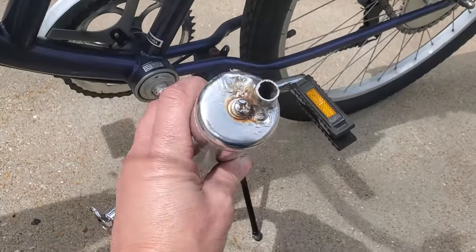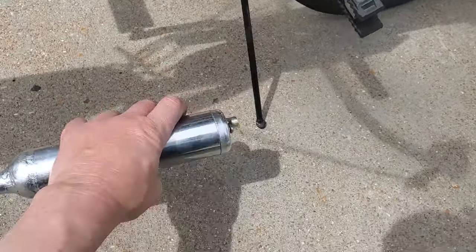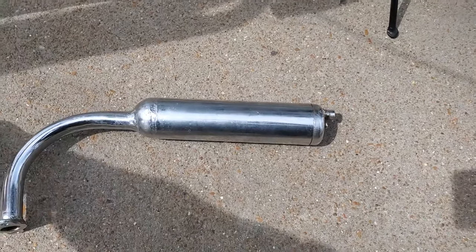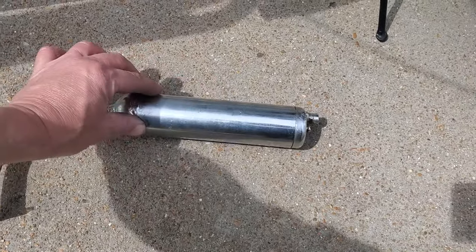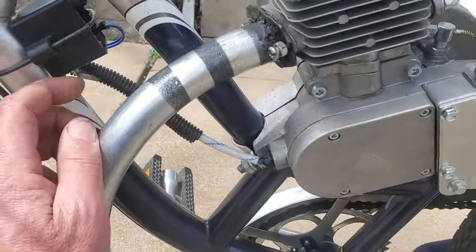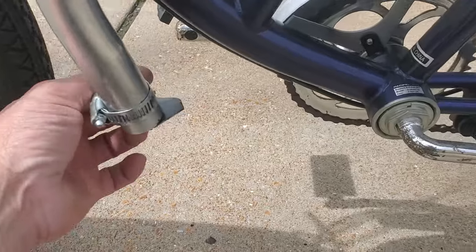Okay, so it's pretty darn small. And then inside of that, if you took that screw off right there and took this cap off, there are baffles that kind of further restrict the flow of the exhaust gases. As gases come out of this pipe, they expand. So this is kind of like a muffler slash expansion chamber. All right, so we don't really have an expansion chamber. The pipe here itself is the expansion chamber,